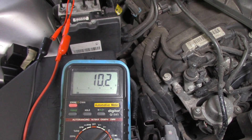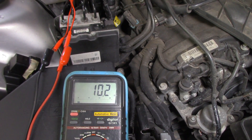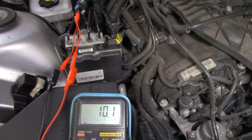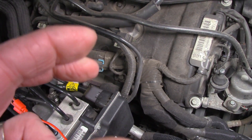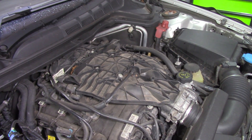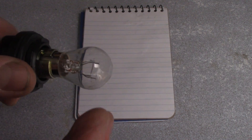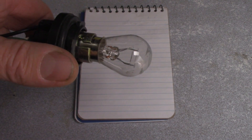So this is the good side. Another test we can do is to see if the ECU is driving that heater via pulse width modulation. I'm going to hook up a globe to the ECU side of things and we should end up with some sort of flashing or pulsing — a long time on then it'll gently go off. That will tell me that the drivers within the ECU are okay.